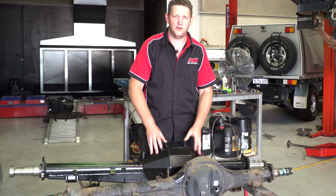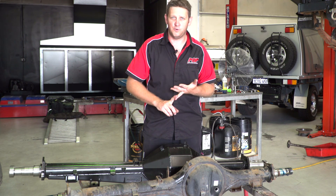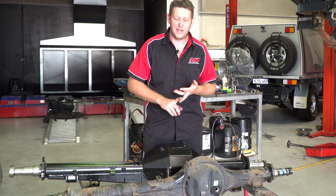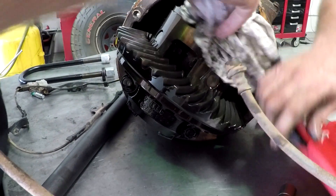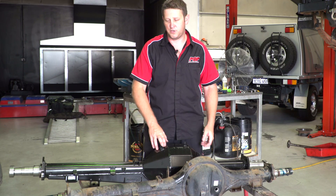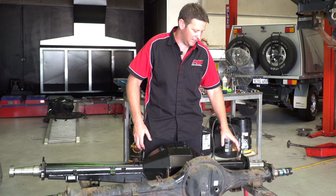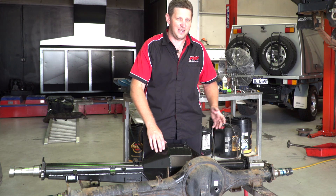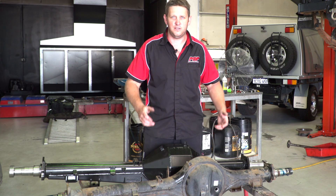So this unit here — what it's going to give you straight away is the track correction. It's bolt-in, there's no grinding or welding. You get chromoly axles with fully floating end caps so you can service them — you're not going to have an axle issue again. Your factory diff locker bolts in — you don't need an e-locker or air locker. If you've got the GXL version with your original Toyota lockers, it bolts straight in. All your factory mounting points are welded onto it. Your airbags for leaf spring setups will all adapt onto it — depending on your airbag setup they can vary a little bit, but everything works, so you're not having to fabricate anything special.